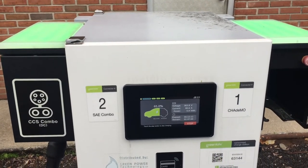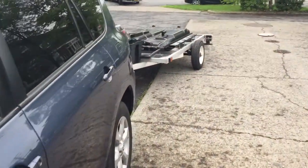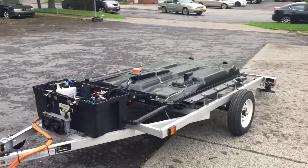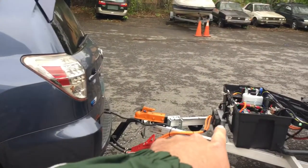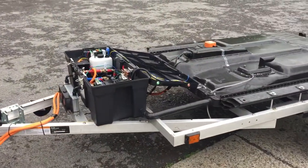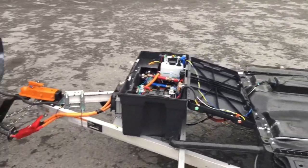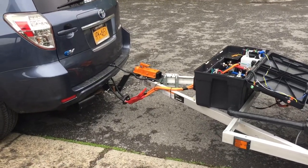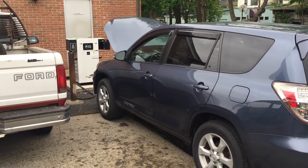Really glad everything's working — this means the trip to Indiana is definitely possible. I just have to keep an eye on the amperages. I did test the amperage at the cable while the car was standing still to see if there was any transfer going on between the two packs, and it was only 0.67 amps. I've been driving around a bit today so it's pretty balanced — less than an amp, which is fine. Anyway, that's about it — thanks for watching and hope you guys have a great weekend, bye!